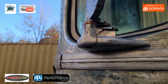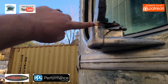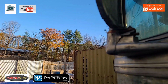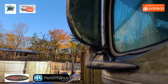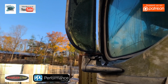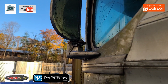Now here's something that you do know about, but now that it's stripped you really see it, is where this bracket, now I'm pointing out the fact that you have a piece there that's brass. The camera likes to keep going in and out of focus there a little bit, but it has this adjustment where the driver can access, and clearly water was able to get in there, and in the freezing elements it expanded and it totally cracked that.